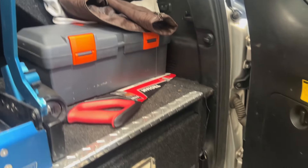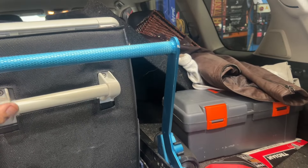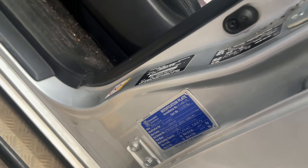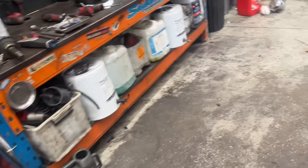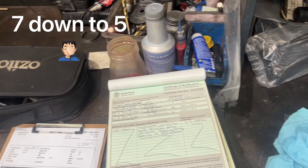So you leave the seatbelts in — you just have to have all the seats removed, and any holes going through the floor to atmosphere outside letting air in will have to be blocked. This one has a complete drawer system. The seatbelts have been taken out and completely removed altogether, but you can leave them in. This one's never going back to seven seats again because obviously you've got drawers, a fridge, and a ring inside. So what we need to do is a mod plate, which is what we've done here. We attach that to the vehicle, and over here I have a certificate of what we've done, showing it's going from seven seats down to five.